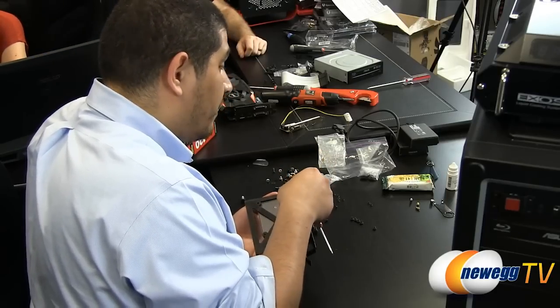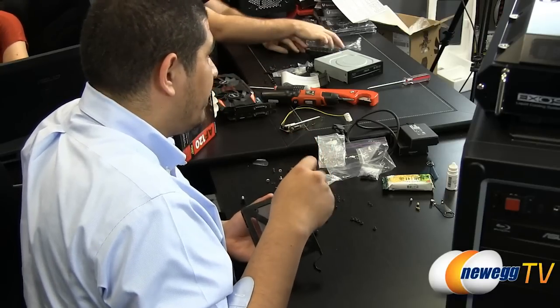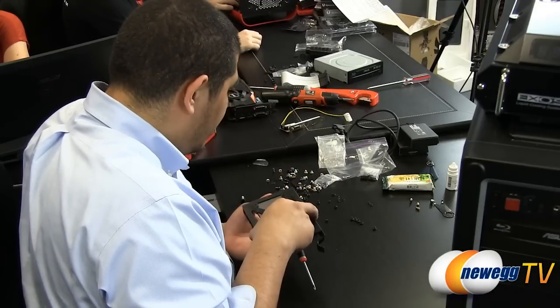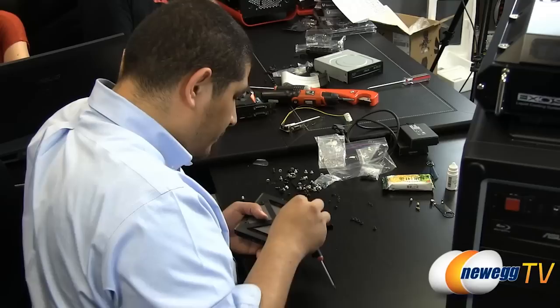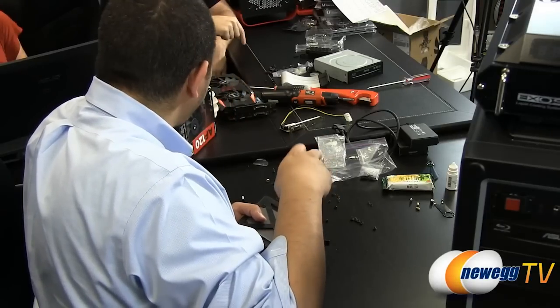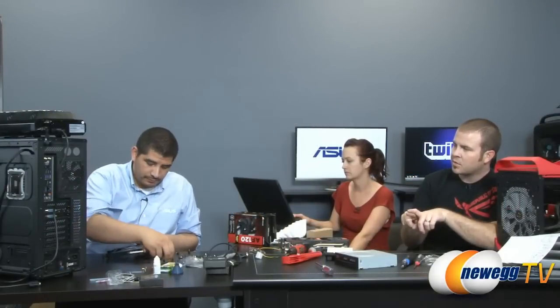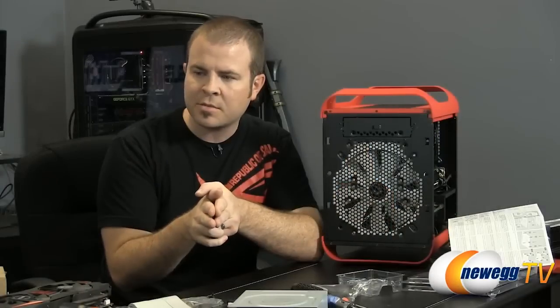Now, if the motherboard were to feature supplemental power connections, like an 8-pin plus a 4-pin, the secondary 4-pin is entirely there for optional purposes, and it's not relevant if you're not aggressively overclocking the system under exotic cooling. In that situation where you have only a 4-pin power connector coming from your power supply, would you say it would be worth it to go with a Molex adapter or something like that to make sure that's plugged in?